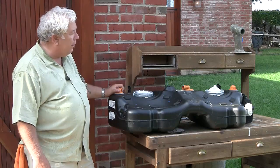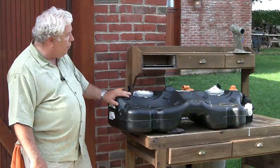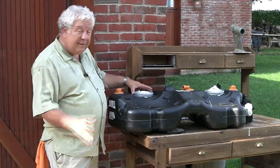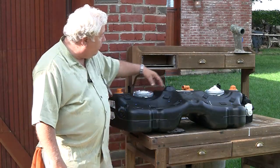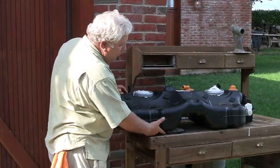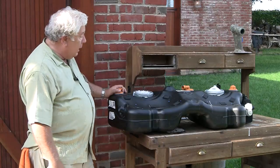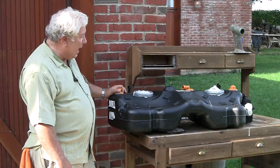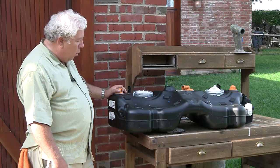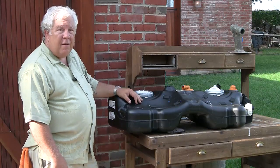And it's going to be quite a little issue for you to disconnect. It's not as easy as dropping the old tank like it was in the old days. This sits underneath the back seats and in fact has a little curvature to accommodate them. We'll show you some access panels to get to this from on top. The tank saddle system is held in place with a clamp here and here on the car, and we'll show you how to drop that. We're kind of filming this in reverse — it took a little bit to figure out how to get the tanks out, and it's changed a little bit of our thinking on the battery layout.